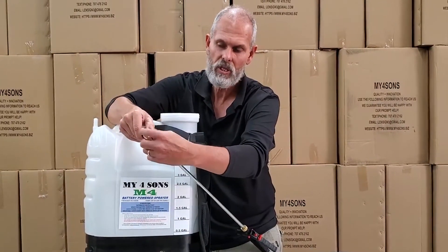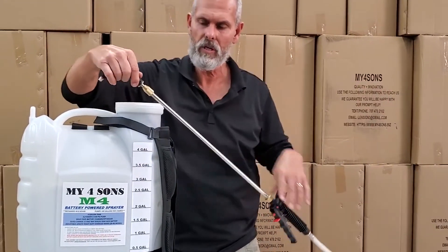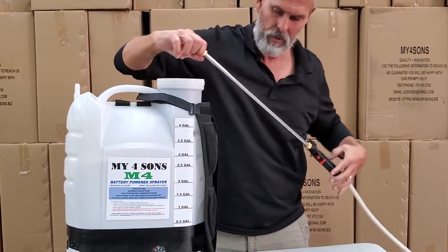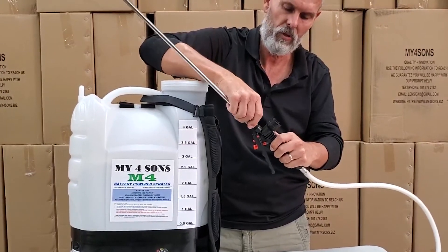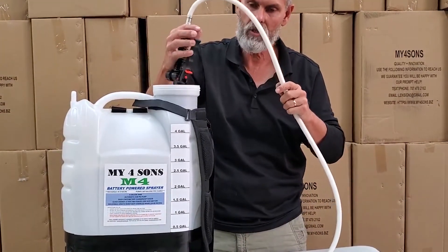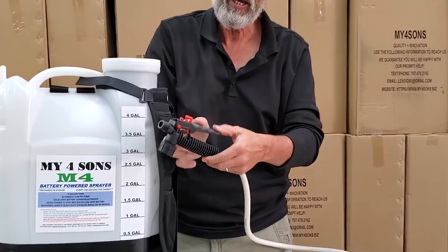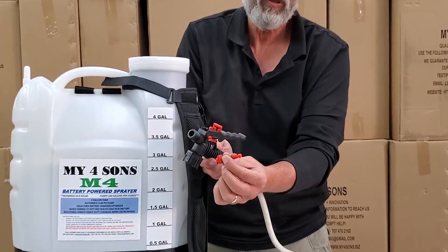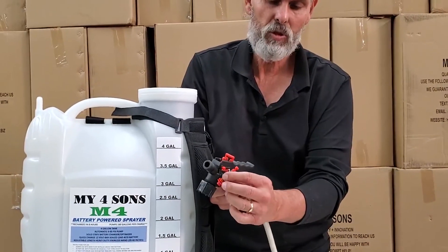Start taking off parts beginning with the nozzle at the end, then pull the trigger. If you don't get flow, undo the flex tip and shoot it into the tank. If it starts flowing, you can narrow it down to the root cause. If you take the wand off and shoot the valve and it still doesn't flow, the reason is most likely the red O-ring piston has an O-ring out of position. We always ship an extra O-ring piston with the nozzles, and we have a video showing how to change it out in about two minutes — go ahead and change that out and give it a try.